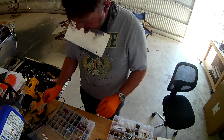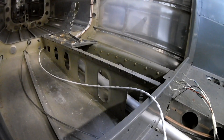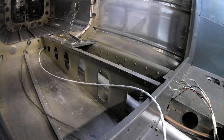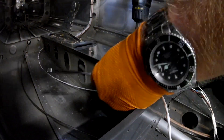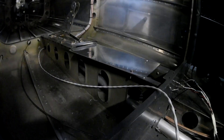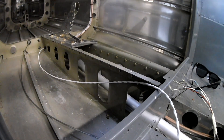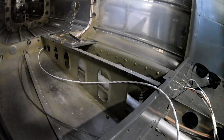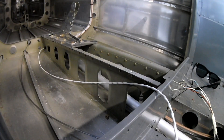The second reason is a CG issue I've described before. The bad scenario in the RV-14 is one light pilot in the front, full baggage, and low fuel — your CG can go aft out of limits. So I'm moving the ELT forward from the very back. It's only a couple of pounds, but because you're moving that arm about eight feet forward, it's definitely going to help, especially since I'm saving a lot of weight up front.